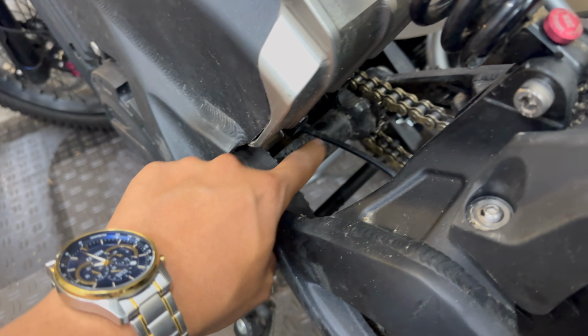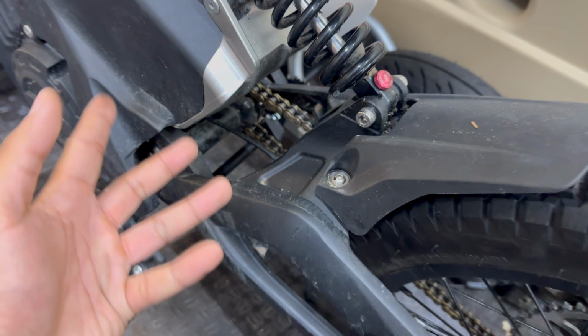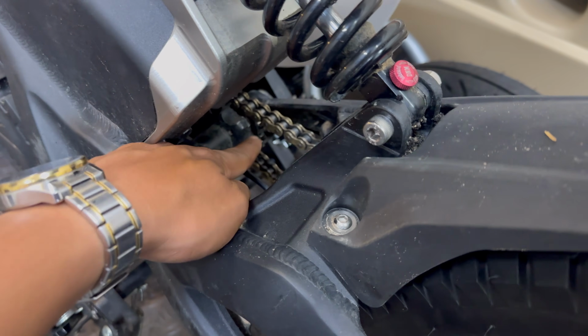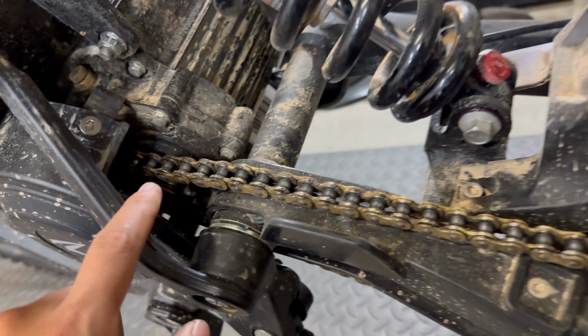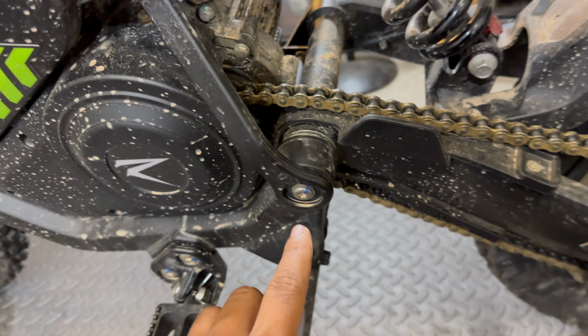There's a belt that connects the shaft to the motor, and the chain tension doesn't actually tighten or loosen depending on how the swing arm compresses, since it rides right on the pivot point. On the Mantis X, however, it goes directly to the gearbox on the motor, which is a few inches in front of the pivot point.